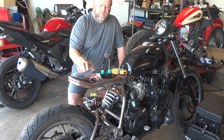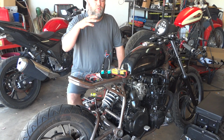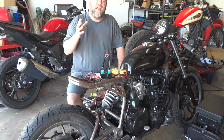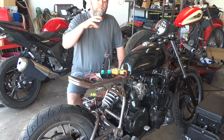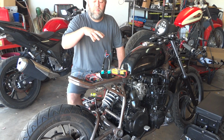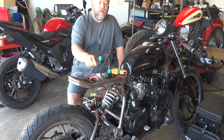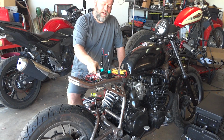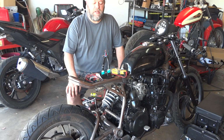And it's a little bit of a theory. I've done this before, like I said, with single cylinder engines and a couple of two-cylinder engines, and it works great. This is a great hack too if your stator goes out, because if you have an AC powered system and your stator goes out, you've got nothing to power your ECU or your CDI. So what you can do is put one of these in, especially if it's a single cylinder, run some 12 volts to it, and run your pulse generator to it, and boom, you've got an operating system.